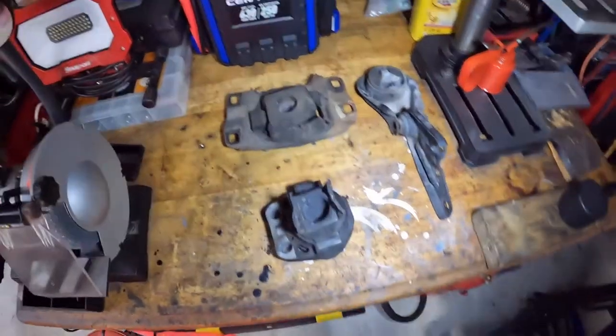And there you go. Test drive was great. You can still feel there's a little bit of slop in the CV axles, which we're gonna go over when we replace them. The front tires definitely need to be changed, and she's gonna need an alignment soon. But that's gonna come after the front struts, because once you change the front struts, you gotta do an alignment as well. So, front struts, alignment, front tires. Bada bing. And yeah, motor stays in place. Perfecto. We like.